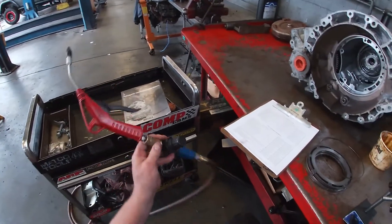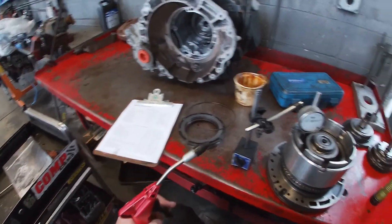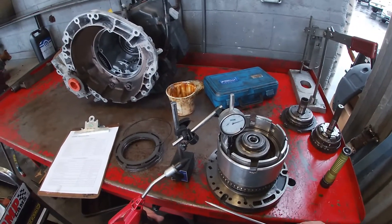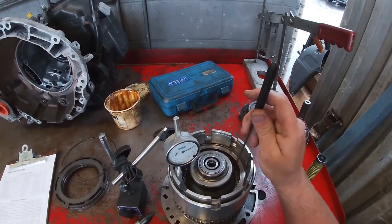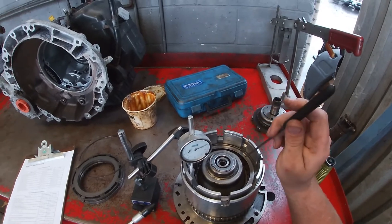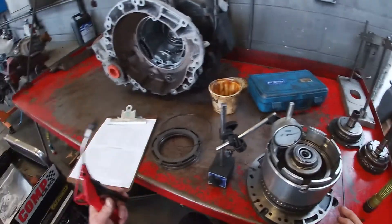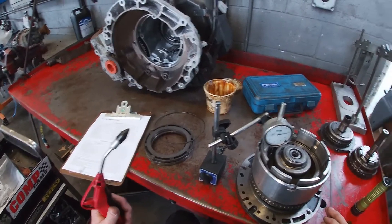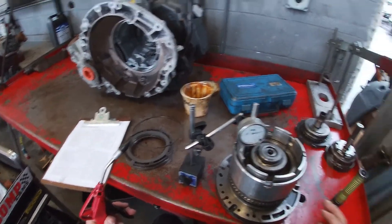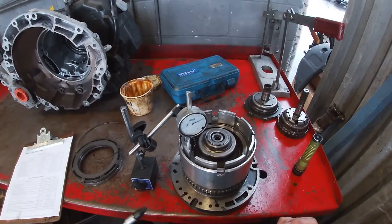I've regulated down my air gun so that it's the minimal amount of air pressure possible. We're going to be measuring the underdrive clutch first — it's the farthest one down in the drum. This is the one that allows the entire drum assembly to shoot up. I have the pressure regulated to around 30 psi, just enough to activate the clutch.